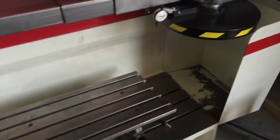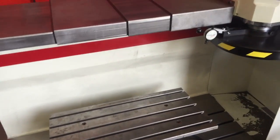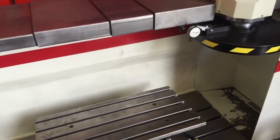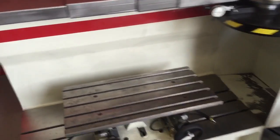Yeah, we can surface exhaust manifolds. Got my little fixture there to surface manifolds. I can surface both banks of the block and the top of the block, the fire deck of the heads, the exhaust manifold side of the heads, and the exhaust manifolds in about 2 hours, and they're done.